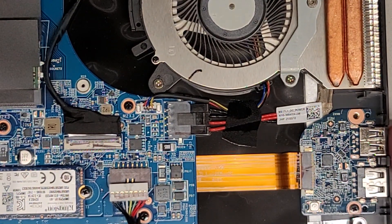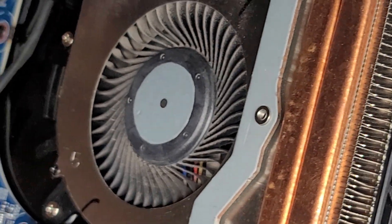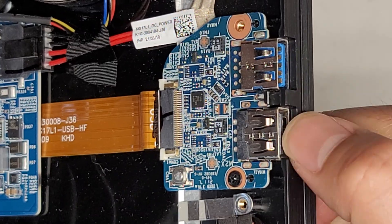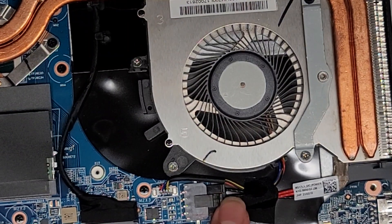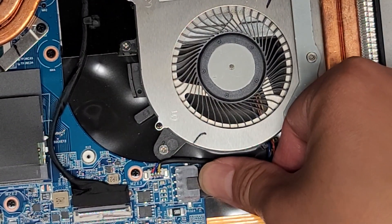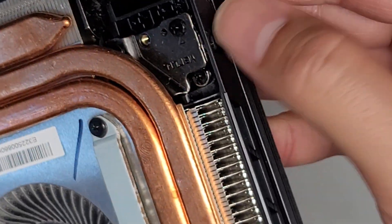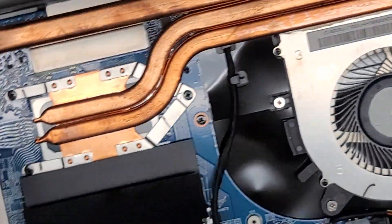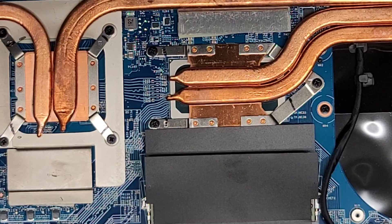There's the connector here for the two USB ports on this side — interestingly, one is USB 3 and one is not, which is odd. There's another fan here with the other connector there. There's also a DC jack charge port connector here — pretty beefy — with a clip you need to push down to pull it out. The DC jack charge port goes underneath the hinge, so if you need to remove the charge port, you either need to remove the entire motherboard or the heat sink. If you remove the heat sink, you'll have to redo the thermal paste, so keep that in mind.